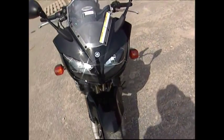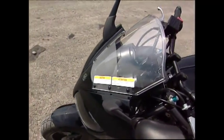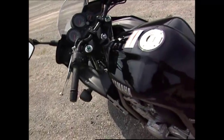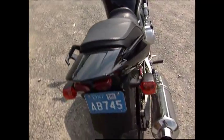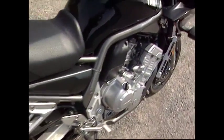The reason for the head swap is because the 1000cc inline 4 now sits in a steel double cradle frame. Up front, you'll find a conventional fork, however the brakes and wheel are straight off the R1. While out back, a single fully adjustable piggyback reservoir shock helps keep the rubber down.